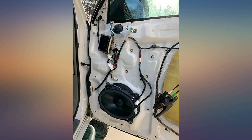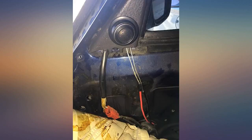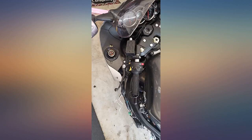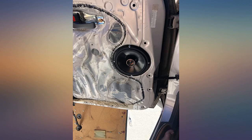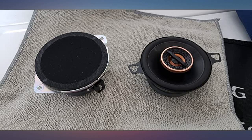These Infinity speakers are a direct replacement for the factory 3.5-inch Alpine dash speakers. I have a 2019 Charger 392 Scat Pack with the factory 6-speaker Alpine system, and these have much better range and overall clarity than stock. Make sure you purchase a pair of Metra 72-7902 adapters for the dash speakers — makes these plug and play on the Charger and Challenger.